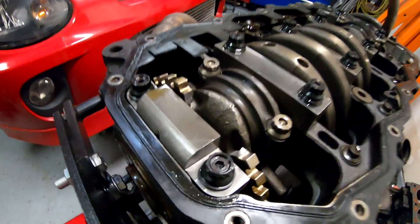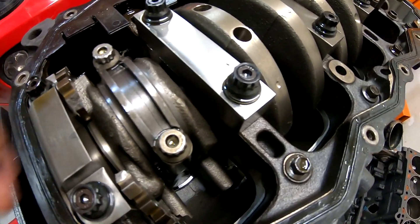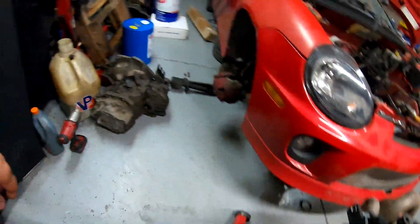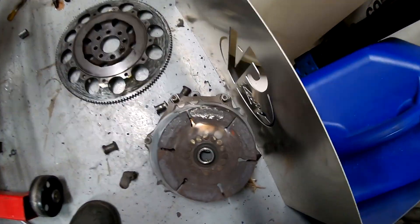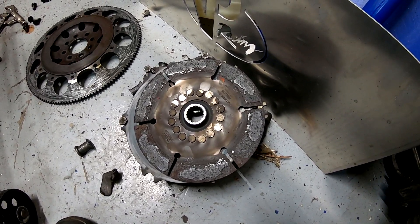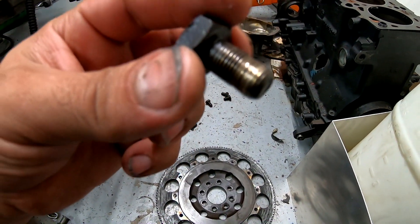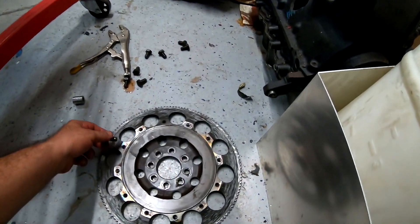It's crazy — look at that. Everything else is complete, it's just this part that is not touching the crank where the vibration made it come loose. Luckily there was no damage to the pistons — it just snapped and laid on the bottom of the oil pan, and that was it. But everything started at the clutch. A slipping or failing twin disc clutch that gets this bad will cause big problems to the engine. Some of the bolts got stripped, and that's why I don't want to risk it with this crank because I don't know if the threads are good.